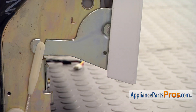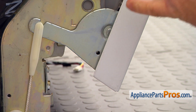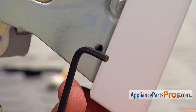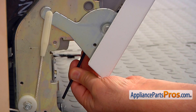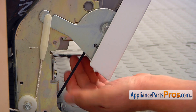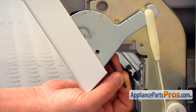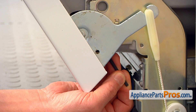And then we're going to open the door approximately 27 degrees or so until the two holes will match. Then using the 5/32 Allen wrench, we're going to jam the door. And now we're going to go on the opposite side, do the same thing. So using the second 5/32 Allen wrench, I'm going to place it into the holes here.